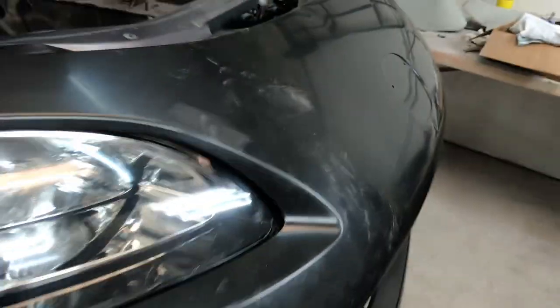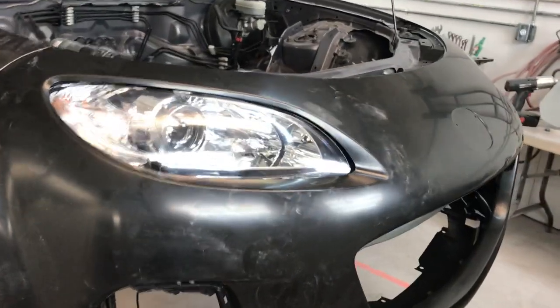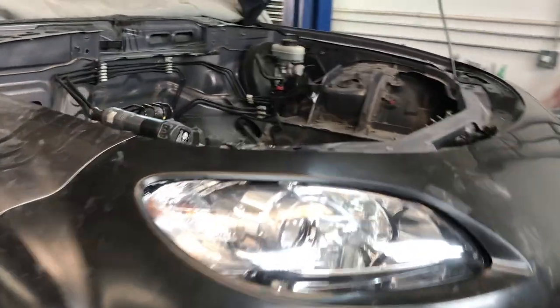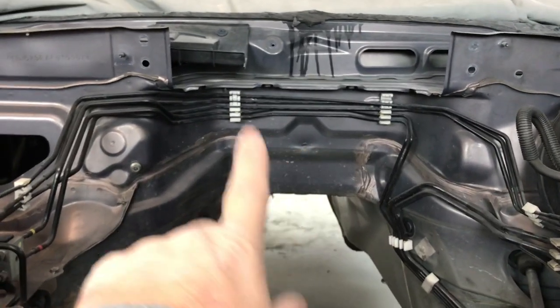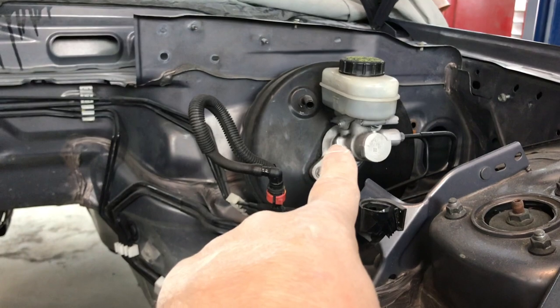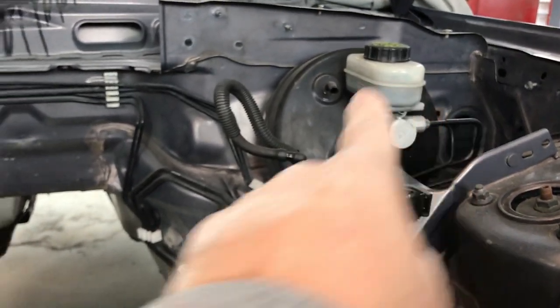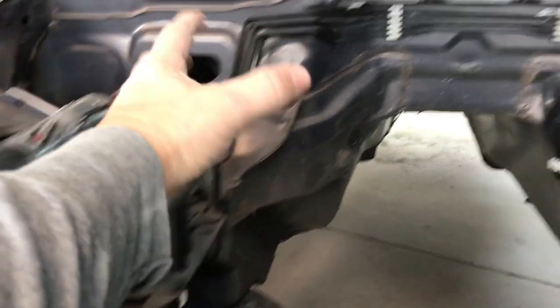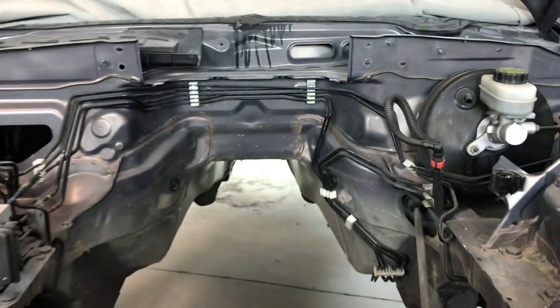The adjustment we made fixed the gap — they're both the same on both sides and everything looks really good. We're going to pull this thing back apart and get it ready to start painting gray. In order to paint this engine bay, we're going to have to get these brake lines out of the way by popping them loose from the firewall. We're going to take the master cylinder away from the brake booster and pull the brake booster off the firewall. We're also going to take this ABS unit and lay everything in the center so we can cover it up and paint all of that area.